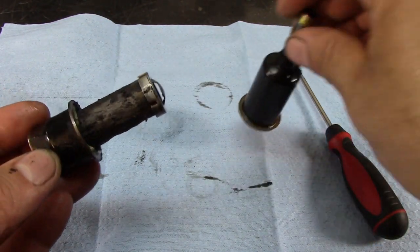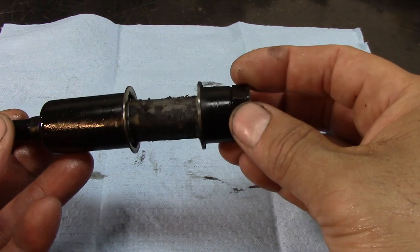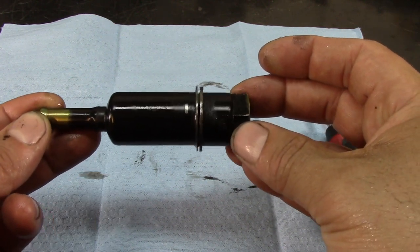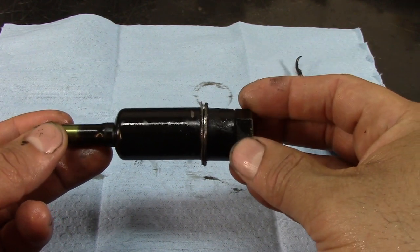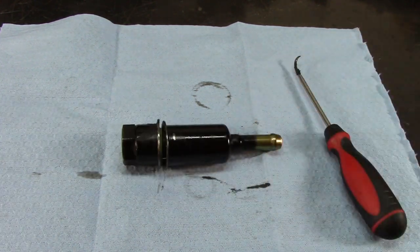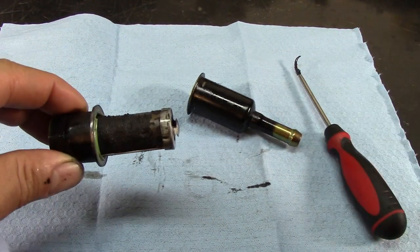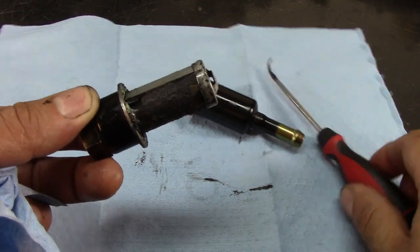For those of you who have a Honda or work on Hondas and didn't know about this little filter — most Hondas have an inline filter somewhere in the cooler lines. This Accord had it underneath the radiator. Civics and later model five-speeds like the SPCA transmissions have the inline filter on top of the transmission. Just keep an eye on it. Inline filters — or cooler return filters — pay close attention to them and make sure you replace them, as that'll eliminate a lot of headaches.